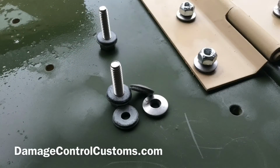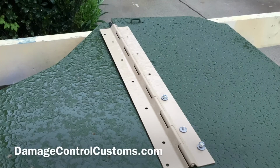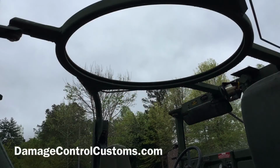These are some of the bolts and fasteners that we chose to use as we reassemble it. If you have a 1045 that was demilitarized, you know that your C-pillar is cut off. So we're going to have to install a new C-pillar by moving one of the sponsons off, sliding in the C-pillar, and getting it ready to seat the turret support.